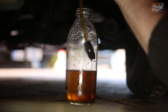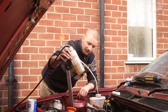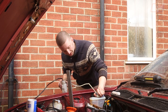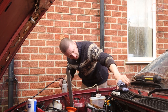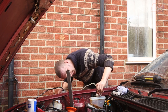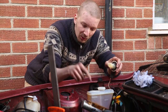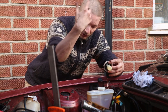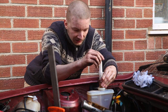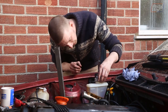We've got all the brake lines purged of air now. The pedal feels absolutely rock-solid, which is great. We're going to take this off and get it below the level of the reservoir so when I pop the cap off, it doesn't pour brake fluid everywhere. The only problem with these things is that it does leave the reservoir absolutely full right up to the brim, so you're pretty much inevitably going to spill some brake fluid. But if you take it off slowly, it lets the air back out, and you can usually do it clean. That went better than I expected. The bottle leaves it so full that if I put the cap in with the level sensor, it will just overflow, so I'm going to syringe a little bit of the fluid out.